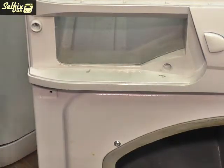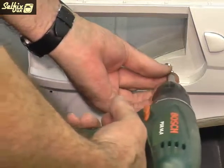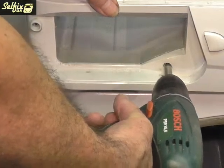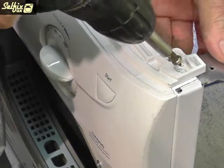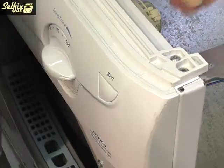You will need to realign the water reservoir ducting before fitting the two screws, as this will hold the front secure, and you can then refit the 3 screws on the other side of the fascia.